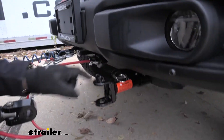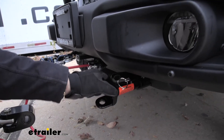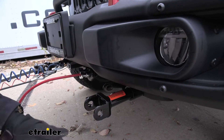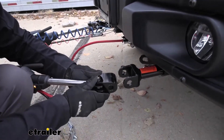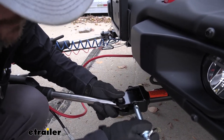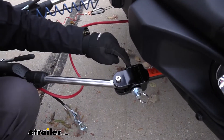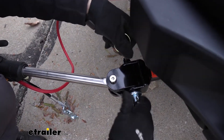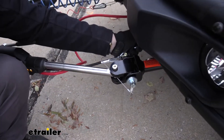You want to make sure that when you're putting it in, these two are on the inside. It's only going to allow you to put it in that way, because if you put it in the other way, it's obviously not going to lock into place. Once you get it in, you take your tow bar, line up the hole, slide it into place, take your pin, slide it through, line up the hole on the pin with the holes on the removable arm, snap your pin in place, and hook up your safety cables.